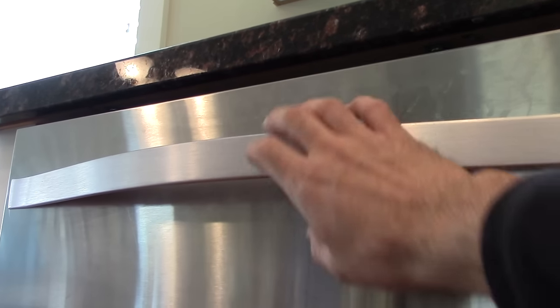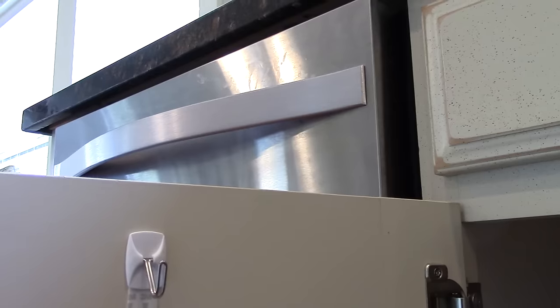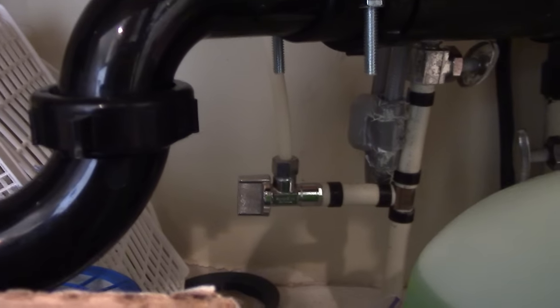If you are going to switch your drain pump, you need to pull out your dishwasher. You can do this by unscrewing these two screws right up under here. And to do any repairs, you can tip it on its back. Make sure you turn off the water that leads to the dishwasher under the sink — this one hooks up with a quarter turn valve.